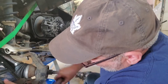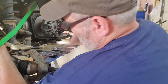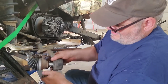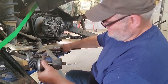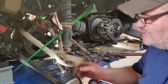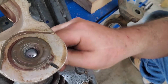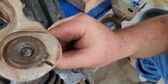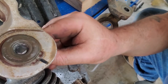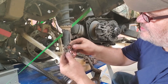Why start now? It's going to take a while. Well, it's always something else - that upper ball joint's got to go. There's supposed to be a little cap here but it's packed right full of mud. You're not supposed to be able to see the ball moving around. You can see there's slack in it once I got some WD-40 in there and broke it apart - that's not how they're supposed to work. Just one more thing for the list. Should have been an indication when I saw the boot was that bad.